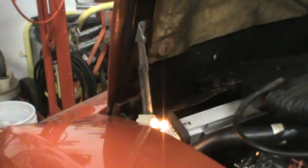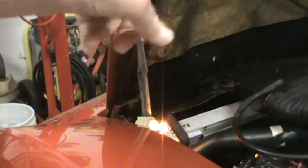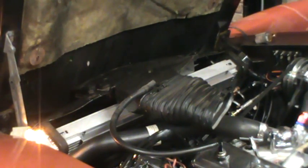If you were doing it right, you should have an eye connector there that you put a bolt through and connect it. So I knew I didn't have a good ground, but when I touched the other end of this to a ground, it really didn't change much. So I started to look at continuity between the ground and the power wires that go from the left side over here to the right where the bulb's not working now, thinking I had a break in either the ground or the power wires or a short between them. And that's where it gets really interesting.